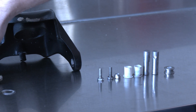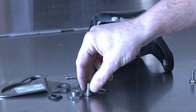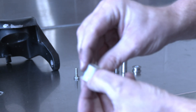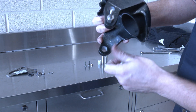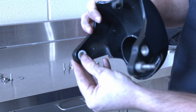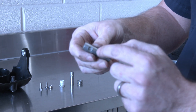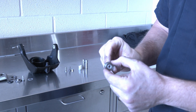When you open this kit it's going to have all the parts you see here: a cam plate, some bushings, an eccentric nut — and it's important to note that the hole on this is not in the center — the bolt for that, more bushings, the reverse gate, and the bolts to put the pins in. For the pins, note there is a detent; when you put these pins in they go from the inside of the reverse gate and you match this detent up with the notch on the reverse gate. Slide it in, push it flush. The other pins also have a detent — the bolt sits in that detent and stops the pin from sliding in and out. Then you have the roller, which goes inside the cam plate.